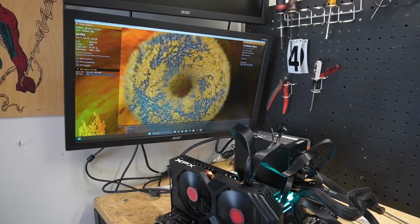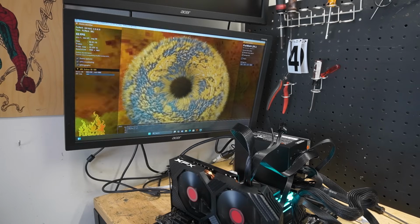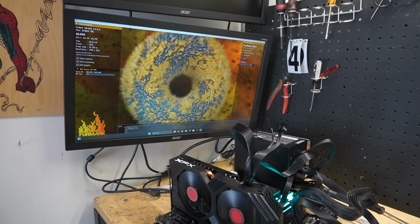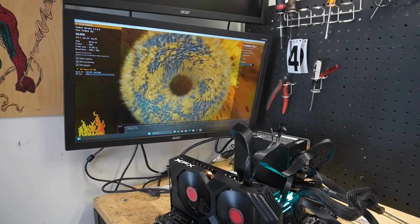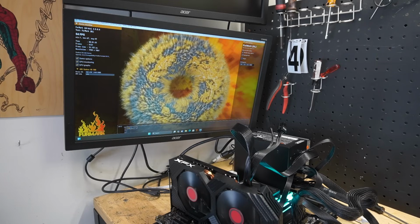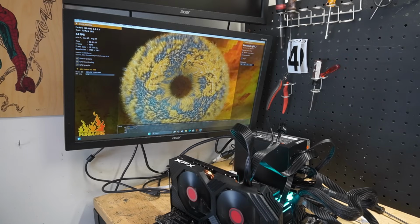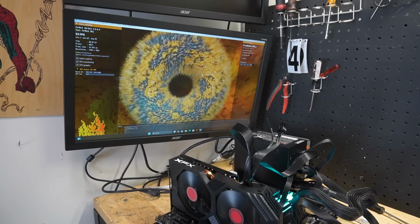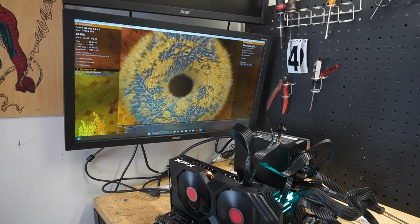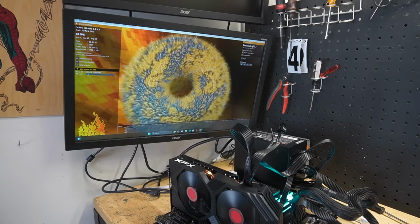It's running perfect. I'm a minute into it, running FurMark, and yeah, it's running perfect. GPU temp is not showing anything, but the fans are not ramping up. I've never seen that, and typically when I've seen the zeros, the card just doesn't work, and it crashes, it artifacts or anything like that. It could be that because they don't make new drivers, I think the last driver for this was October 2024, maybe that's why it's not picking up in GPU-Z or even over here. I'm not 100% sure. Chime in the comments, but as far as I can see, this thing is working.